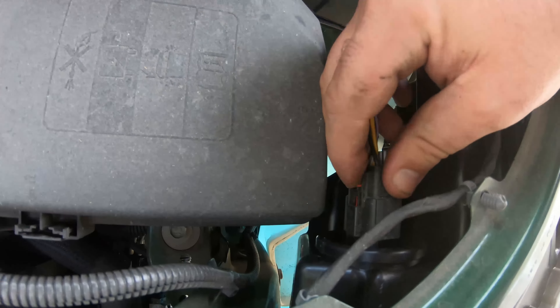I've got some seven mil screws here. What I'm doing is pulling this plastic back just a little bit, but the appearance of these headlights is very nice, so I don't want to pull the plastic until it's in here with a hundred percent certainty. You just kind of slide it up in here like this — there's a little notch that has to get up and over.